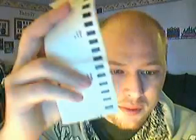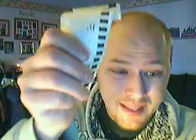On continuous feed, though, it's just a solid pattern, and that lets the printer know that there is, in fact, stock in the printer. Now, if it doesn't see that, it stops because it thinks, oh, gee, there's nothing in there, and I'm not going to burn up my thermal print head just printing on nothing. So what we've got to do is get that optical sensor to see this pattern all the time, even when there's nothing in it. Yeah, you can burn up your printer this way. Just make sure to always keep something in it.